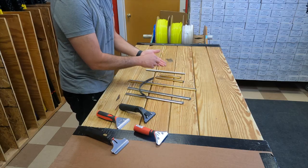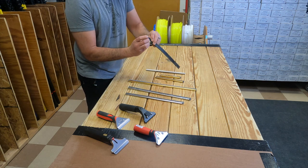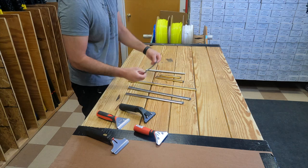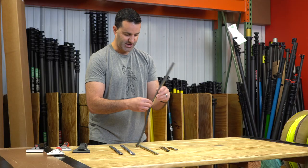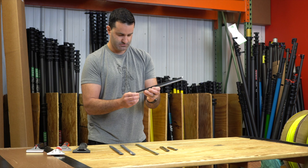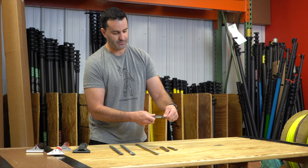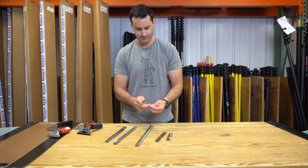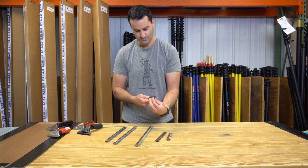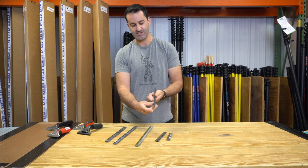To reinstall a rubber in a clipped channel, simply take your rubber and hold it. There are little tiny teeth on the brass — sometimes you have to bend it open a little bit and clamp it down on the rubber. Slide it into the channel. It doesn't matter which way the brass clip goes in; there's no front or back. Push it in. Once one side's in, pull the rubber out about an inch on the other side and hold it down with your thumb. Open the other brass clip, pinch it on the rubber leaving maybe an eighth of an inch hanging over, and push it in. And just like that, you're good.